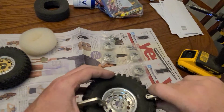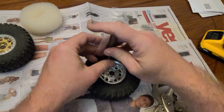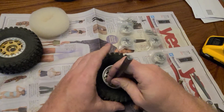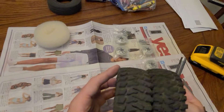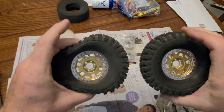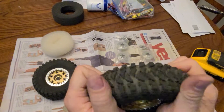Now that I've pretty much got it where I want it, go ahead and remove these clamps. Just make sure that we are snug - that's pretty snug there, nice and firm. Look at the difference - same amount of effort. See the deformity on the stock foam, you can just roll those over so your side hilling is not going to be as good, whereas the hair donut is firm, it's packed in there good.